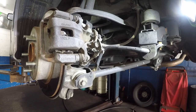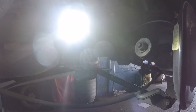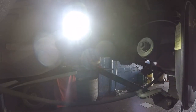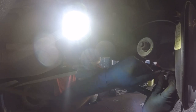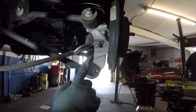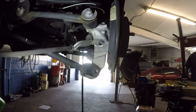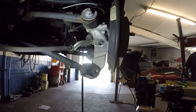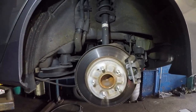That's two bolts in. Now go back and put the number 12 bolt back on the emergency cable as well. Tighten that bolt and that's it. You see me use the electric gun — don't do that. Just use hand tools: a ratchet or gear wrench, because the gun is not that strong. And that's it — brake pads are installed! Please subscribe to my channel, share and like my videos. Bye and I'll see you on the next one.